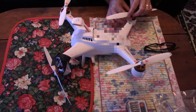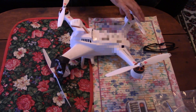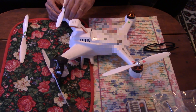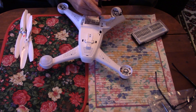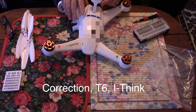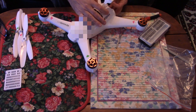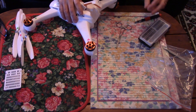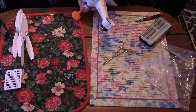Let's get into fixing this thing. The first thing we need to do is remove the propellers. You should already be familiar with this procedure and know that two of them are removed counterclockwise and two are turned clockwise to loosen. Next, using a T5 Torx bit, remove the four screws for the wire cover. Next, remove the GPS antenna by pushing in on the clip with a small tool to release it from the body. Then turn the Chroma over and remove the antenna connector from the main board. Take note of where the black insulator goes and remove the antenna from the aircraft.